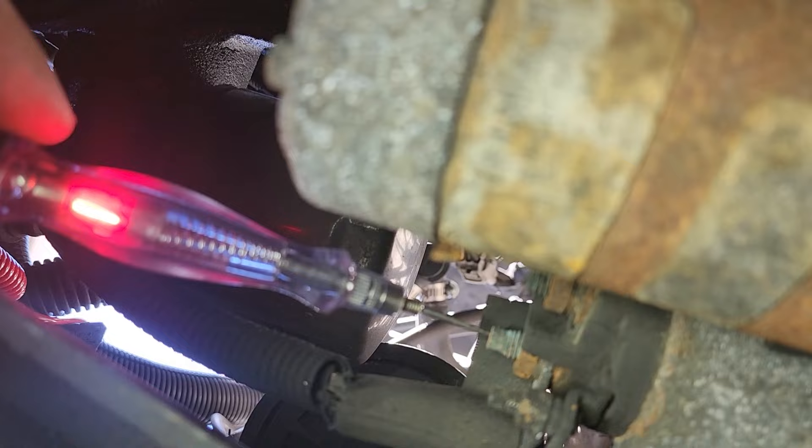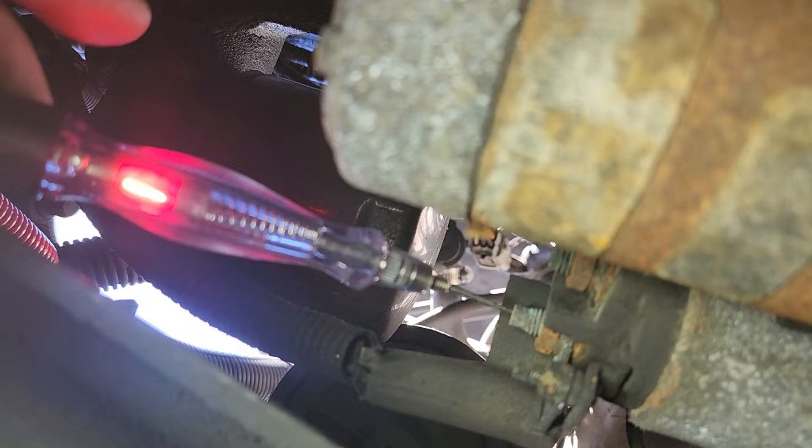You notice the light dimmed — that's totally normal because you've got around 150-amp average, honestly a 500-amp surge on initial crank. So that light dimming is fine, but that's what you want to see. You never want to see that light go out. One more time.